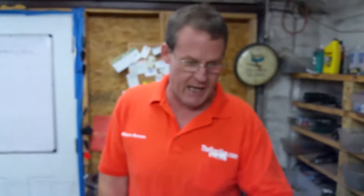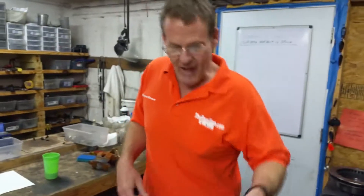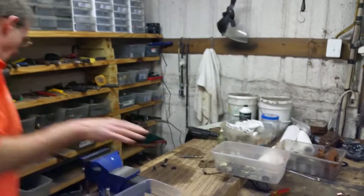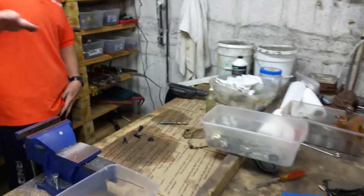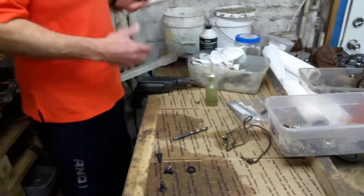You have to remember something: brake fluid was formulated to work with some of them older rubbers when cars came out. It was made specifically — they had to find something. If we go over to DOT 5 or petroleum products, any hydrocarbon petroleum products combined with natural rubbers or whatever, you can get a really bad reaction.